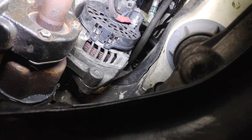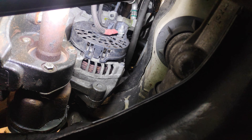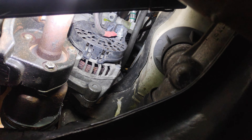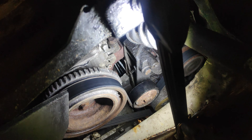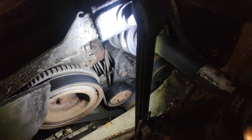I've just remembered — I've got to disconnect the battery, so those cables are going to come off. Then there's two bolts, and I've got to take the belt off as well, which is up there. We're going to get that tensioner, drop that belt off. Anyway, I'm going to get this done because yeah, it's looking good.